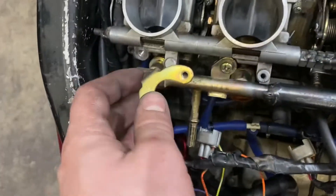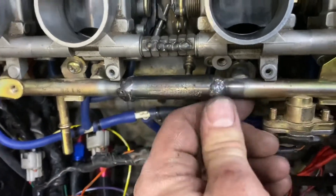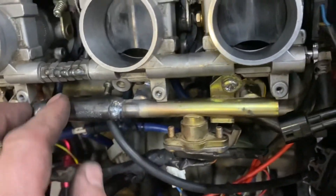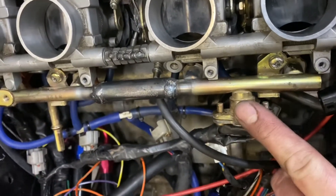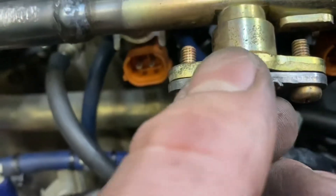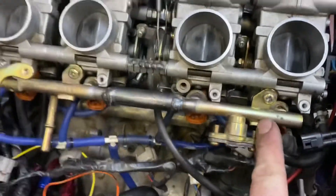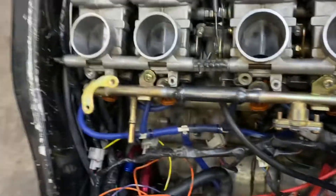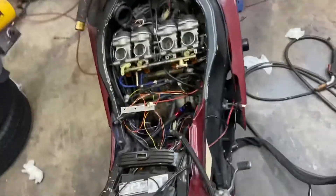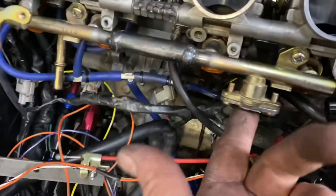Now we have the fuel rail installed — got that welded up nice and solid. If you're not a proficient welder, definitely don't do this. I have a returnless fuel pump from an R1 sunk into the tank. If you're doing the returnless route, you can take off or cut off the fuel pressure regulator and weld up the hole in it — that just makes this no return, so you can use it as a returnless fuel rail. My old one was actually threaded in here so I was able to just put a pipe thread in there, but this one was smooth. Little differences over the years — anyway, I just welded that up.